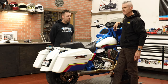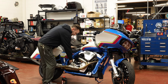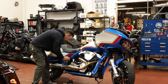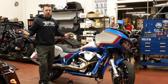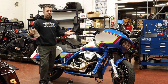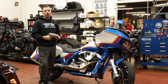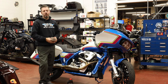We just got back from our hot oil check. I'm going to do our final check on the engine oil level. Got it on the jiffy stand. Wipe the dipstick clean, thread it fully back in — right where we want it. We're good to go! And that's it — that's step by step on a three fluid service on your Milwaukee-Eight bagger. Hope this video was helpful. Hit that subscribe button and notification button. If you have any questions, hit them in the comments below. Check out our website at tuckerspeed.com. Stay tuned for more videos coming soon.